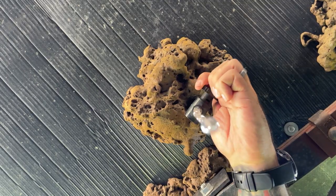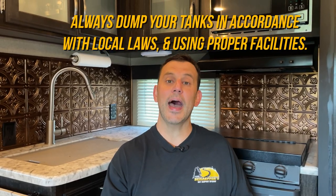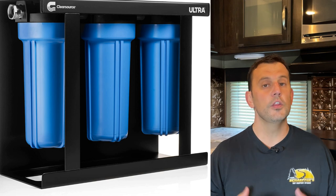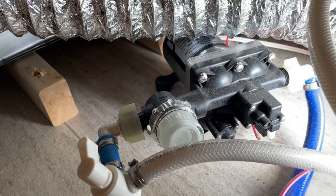The first thing you want to do is empty your freshwater tank. And if your gray tanks are close to full, you want to empty those as well because we're going to be putting water back into those gray tanks. Next, any water filters that you have on your plumbing system should be removed or bypassed at this point in time. The only exception is the filter on your water pump — there probably is one there — but for this video, you can leave that one on. You don't have to bypass it.